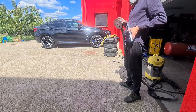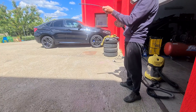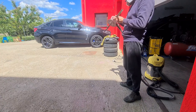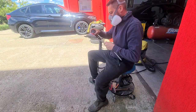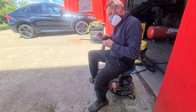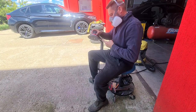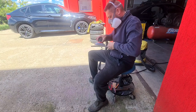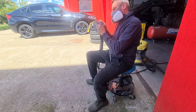It just might happen that I will need to resand and respray all the blacked out trim that I've already done on the car, as I encountered that some paint is peeling off in a few spots. I think that the sanding was just too fine and I need to use a rougher sandpaper. We'll see that in a future video.